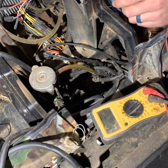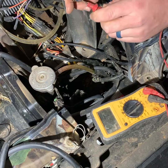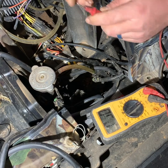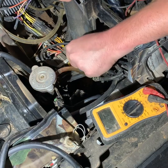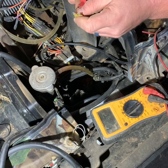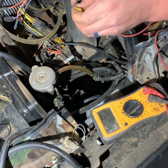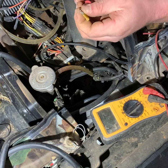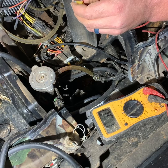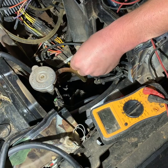I'm going to check my fuses now. I've got my multimeter set on continuity — whenever you touch the leads together it sends a tone. I haven't looked to see which fuse is actually for the fan, but I'm just going to show you how to check them. Take one lead to one side of the fuse and the other to the other side. I have continuity, so that fuse is good. I'm going to go through and check all the rest.